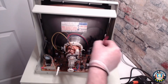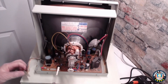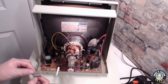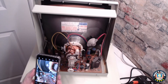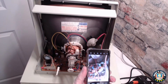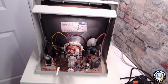Before we start doing other work, we take a look at everything to make sure nothing looks burnt, destroyed, or damaged. Here we're pulling off the connectors — this one comes off and goes back in one way because it has a plastic piece. Ensure that before you start taking things out, you take your phone and photograph everything, because you don't want to plug cables in the wrong spot. If things go in the wrong spot you could blow up the monitor, blow up the board, catch fire — who knows.